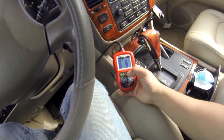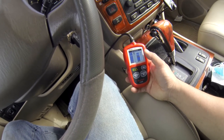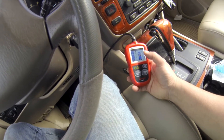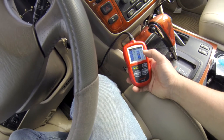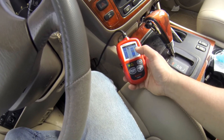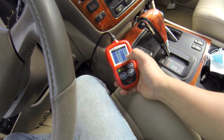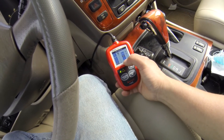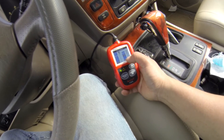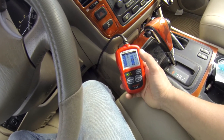After converting the O2 sensor from the 2006 Tundra to fit the 2000 Lexus LX470, the swapped sensor is good. I've driven about 50 miles and now everything is complete except the EVAP monitor. According to California regulations, you're allowed to have one item incomplete. As long as the CAT converter and O2 sensor monitors are complete — and the EVAP — that is acceptable to pass smog. So now it's complete and this car should pass smog no problem.